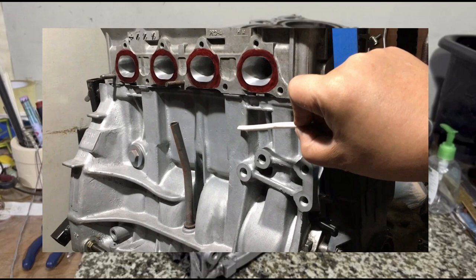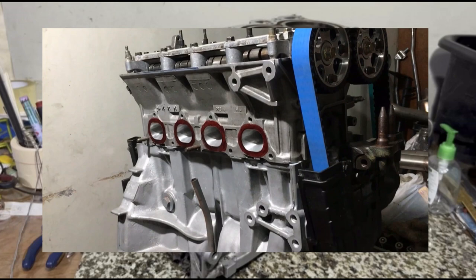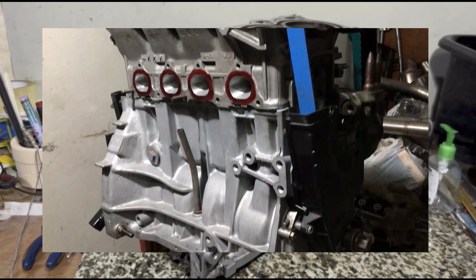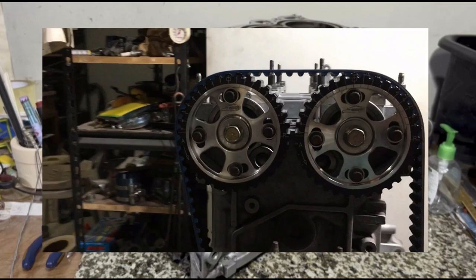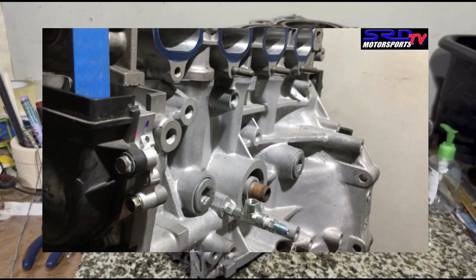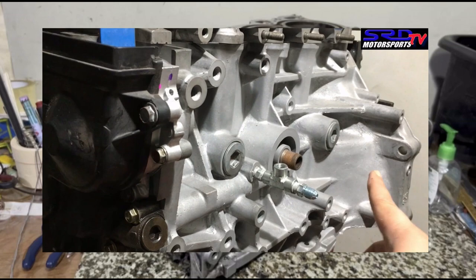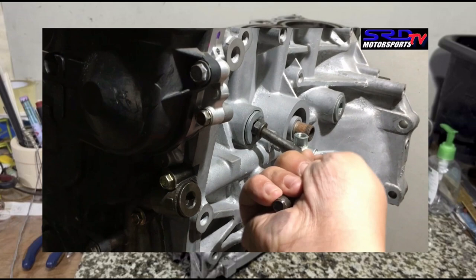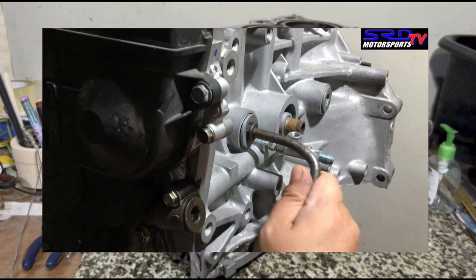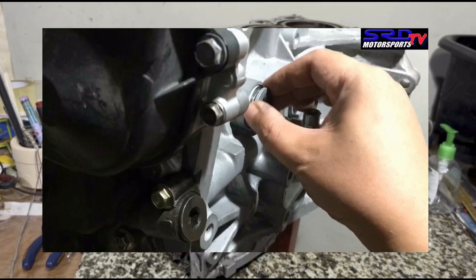Here is the drain from the head back to the block for the oil. When you look at the back there are also two ports, but the difference is out of the back there's a block plug fitting. Here on a B20 block this is an allen fitting — we remove this and put in a block fitting that you can connect a hose to, into the breather box. This way crankcase pressure gets to breathe out even if the oil drain is filled with oil draining back down, because that happens whenever you're above 5,000 RPM.